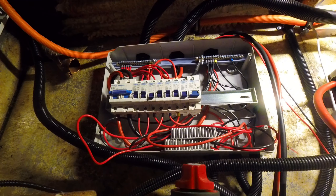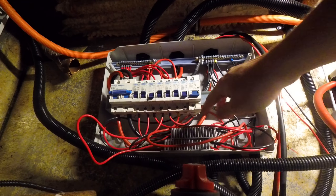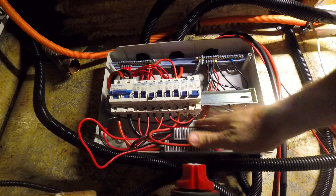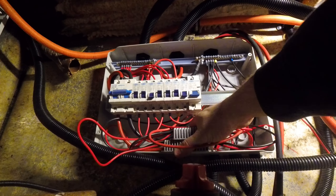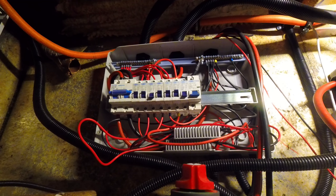The other breakers are sending battery voltage through and off to two 48 volt circuits around the bus. There are also two 20 amp 24 volt step-down converters powering 24 volt circuits around the bus. These are okay for now — eventually they'll be housed in their own box. The reason we went for 48 volts was just to gain efficiency in the inverter and for future power needs.